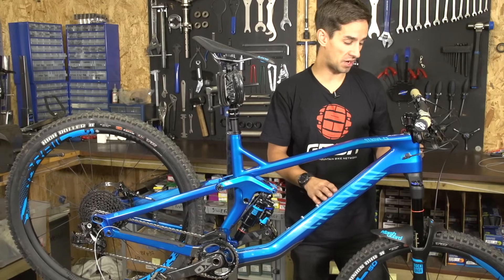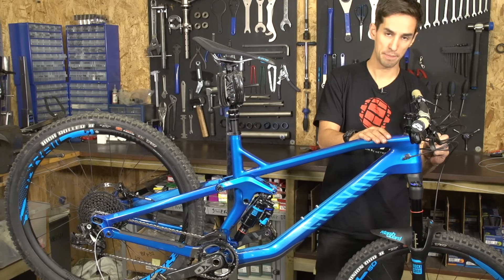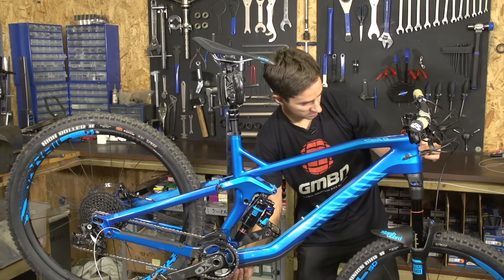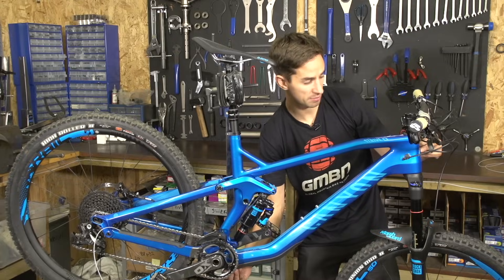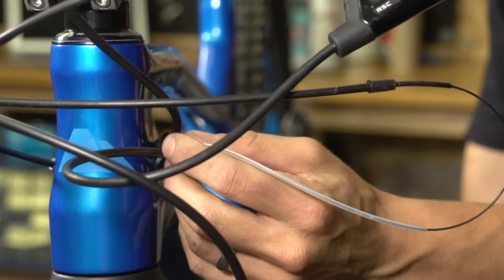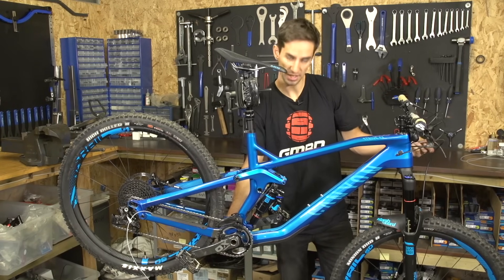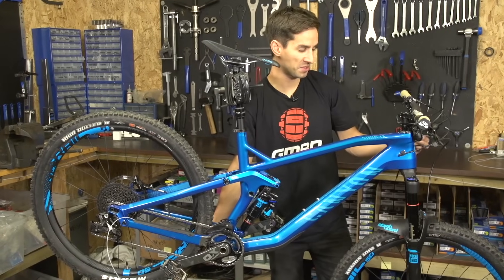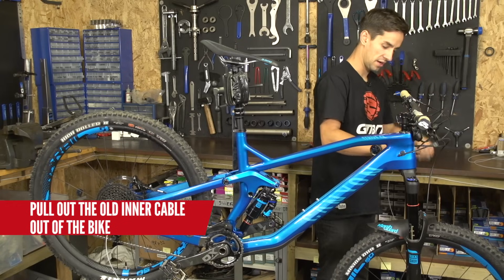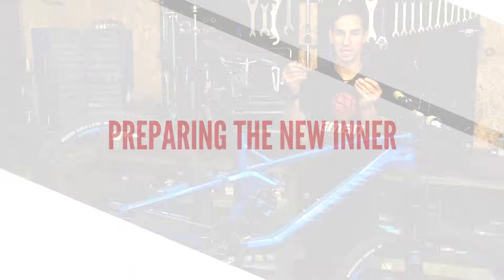Same now with the main part of the frame. I've just pulled this outer cable out of the head tube, so I can just pinch the inner cable between my fingers, so that when I'm pushing this cover, the inner cable isn't just gonna push out of the bike - I'm just pushing this inner cover over. Now I've got this little tube all the way through the bike. This tube's gone all the way through the frame; I'm pulling on one end, I can feel it pulling the other, so I know I'm safe now to pull the old inner cable the whole way out of the bike, and I can measure up my old outer cables to replace them.